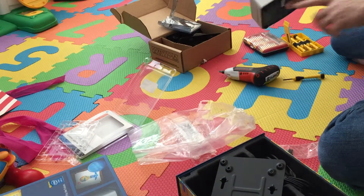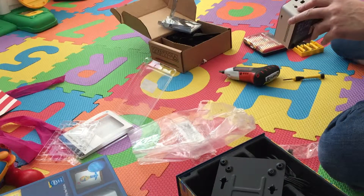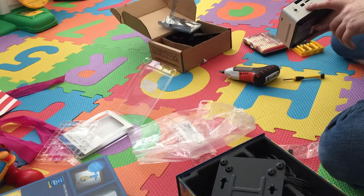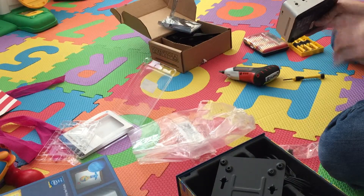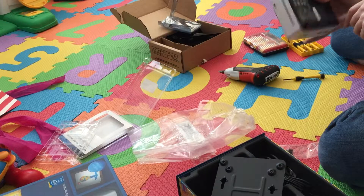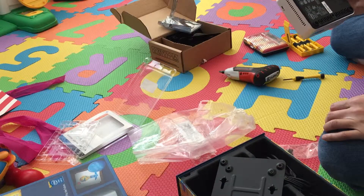Here are a couple of USB ports and audio, but I don't care about the audio — I'm going to install ESXi on it, server OS. There's power, a Thunderbolt/Mini DisplayPort, a mini HDMI port, and two additional USB ports. What I'm going to do is install ESXi on a USB stick. If I have other stuff to plug in, maybe a mouse or keyboard, I might plug in here.